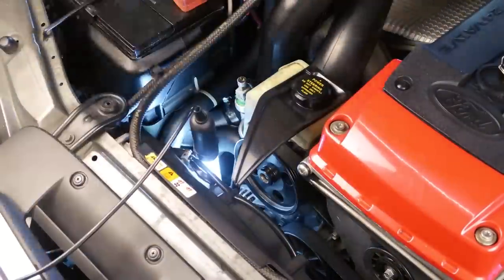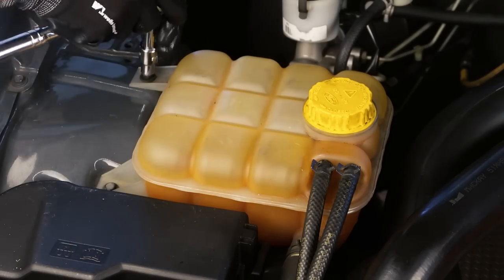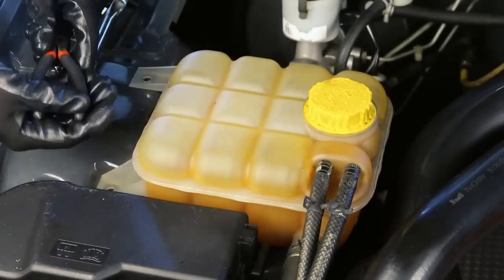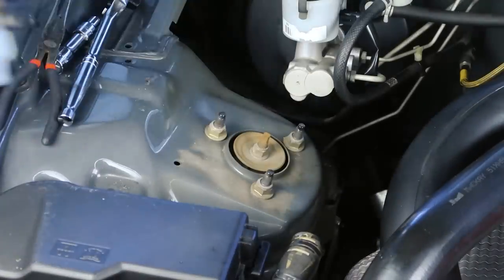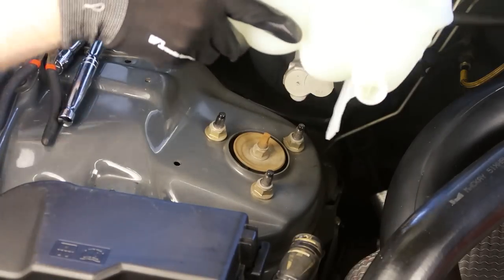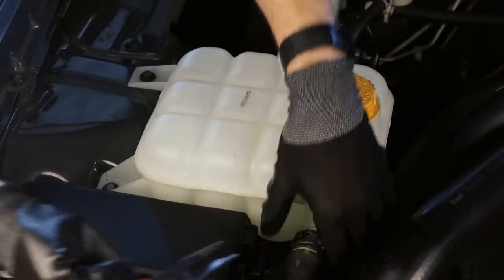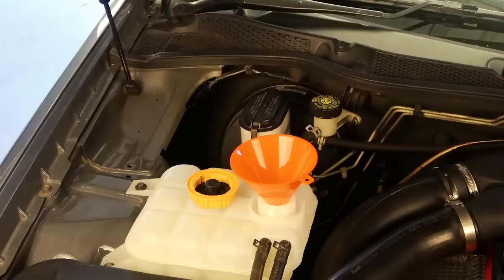First up, I'm going to reinstall the lower radiator hose. Before I can refill the system, I'm going to have to swap out the reservoir. To do this, I simply need to loosen the two bolts on the driver's side of the tank, and then loosen the three hoses which connect into it. I'm using a pair of pliers to release the pressure on the hose clamps and then pull them out of the way. With all three removed, I can finally get rid of this reservoir for good. I'm then going to give the surface here a bit of a wipe down before reinstalling the new tank — it's really just the reverse of what we just did. Lower the tank down into place, there's a little notch you need to fit the tank into before reinstalling the bolts, and then finally reconnecting the hoses, making sure you reconnect them in the same order, especially the top two which are the same size.